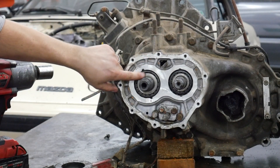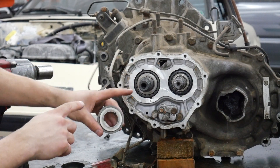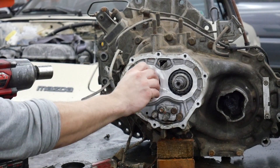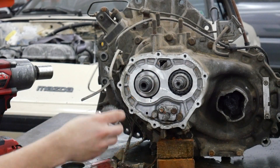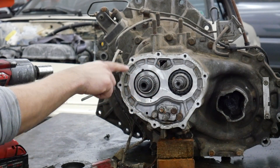Just set it in there like that. On the sleeve there's a detent — much like a woodruff key on a crankshaft — and this slides in and locates the sleeve, keeping it from spinning. And this is what the needle bearing, which is for fifth gear, rides on.